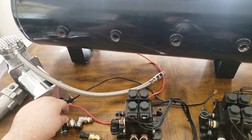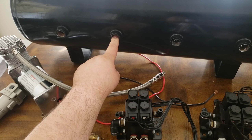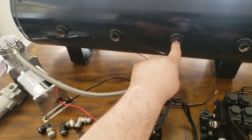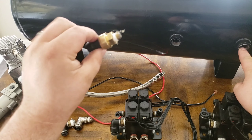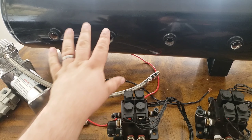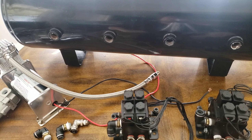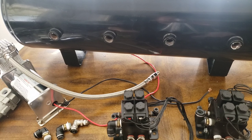Your tank will have one port dedicated for the front, one port dedicated for the rear bags, and one port dedicated for your sensor. You should also have a drain on the bottom for condensation. And you may use another port — whether it's on the side, the top, or wherever — for a fill-up valve, if you want to inflate the tank if your compressor fails, or if it's just quicker to fill up the tank with another compressor on the side.